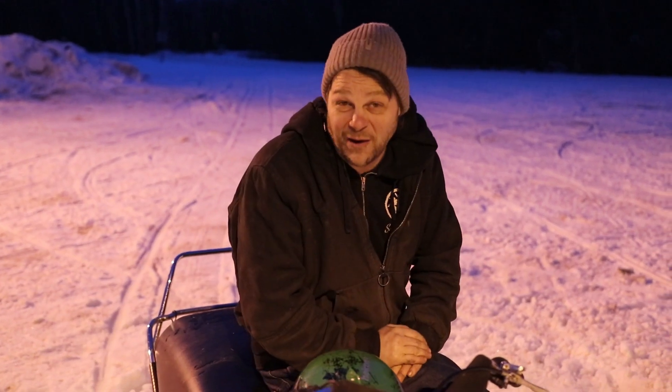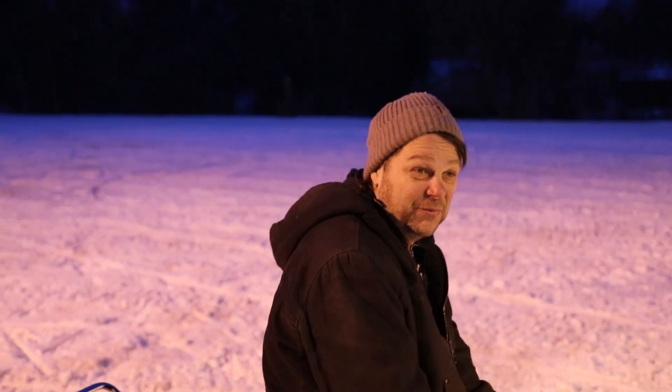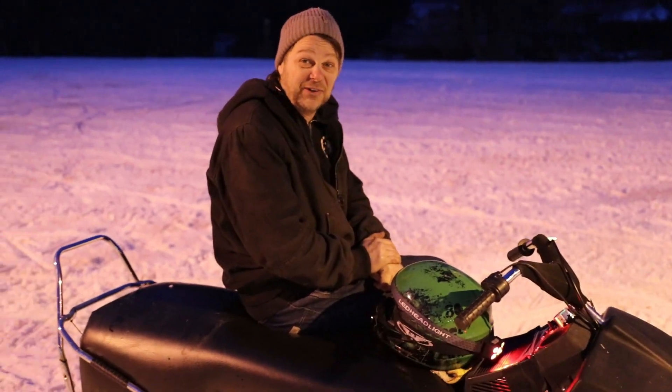We made it to Iron River - pretty stoked. Did about 12 miles and we are at 57 percent. There we are: 78.3 volts, 57 percent. I'm going to try to get back. One thing we like to do when testing batteries is see what happens when they get to zero, so we might experience that. It is dark because we did lose a tensioner on the snowmobile - nothing really related to the electric conversion, just an old sled. We put another bolt in and it seems fine.